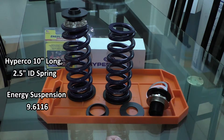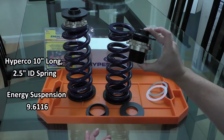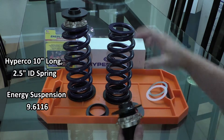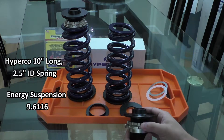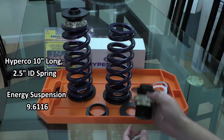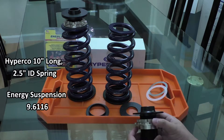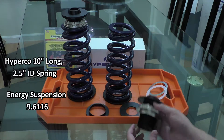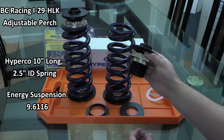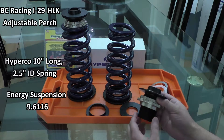Working our way up from there, here's where most of the magic is — the rear height adjuster. The F2X and F3X rear upper spring cup is the same as the one used in the previous E90, so if you've got a set of old E90 coilovers with the height adjustable rear you can reuse those. The other way is to do what I did and go to BC Racing — they sell their rear height adjustable spring mounts, and you can get two of them shipped for $100.